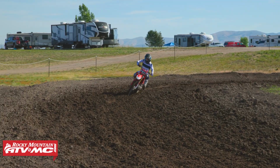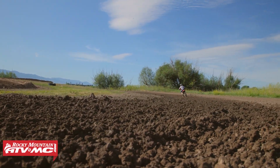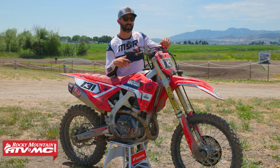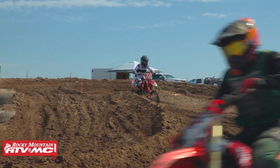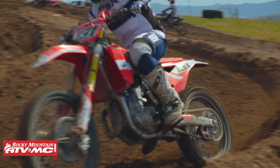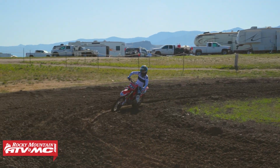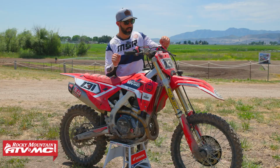So as I mentioned earlier, they have redesigned the carcass of the front and the rear, with a new tread compound. With the previous MX-32s, I think a complaint some people had is that the carcass would start to break down sooner than other tires. You just wouldn't get as much time before you'd start to feel that sidewall start to roll. So they've increased the stiffness on the sidewall. Again, new tread compound just to get better durability. The older MX-32, like I said, I love that tire, but it would start to tear knobs pretty early.